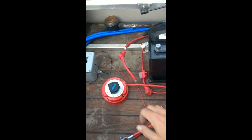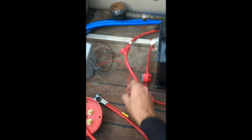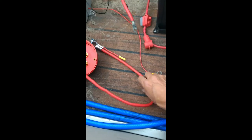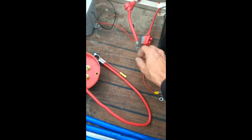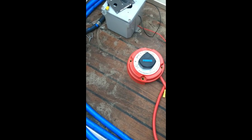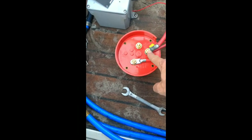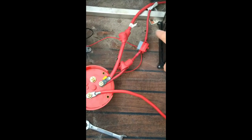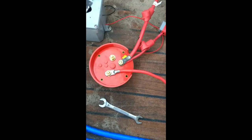Now I'm on the boat. I've got the battery completely disconnected and I've already got my cable hooked up here. We're going to take the three wires that feed the boat — this one goes to my water pump, which I'm going to have an upcoming video on how to install. These are my main cables here; they are going to connect to this point right here. Then I'm going to screw this down somewhere and hook up the ground and we should be good to go. Here are my connections — this is what's going to feed the boat.